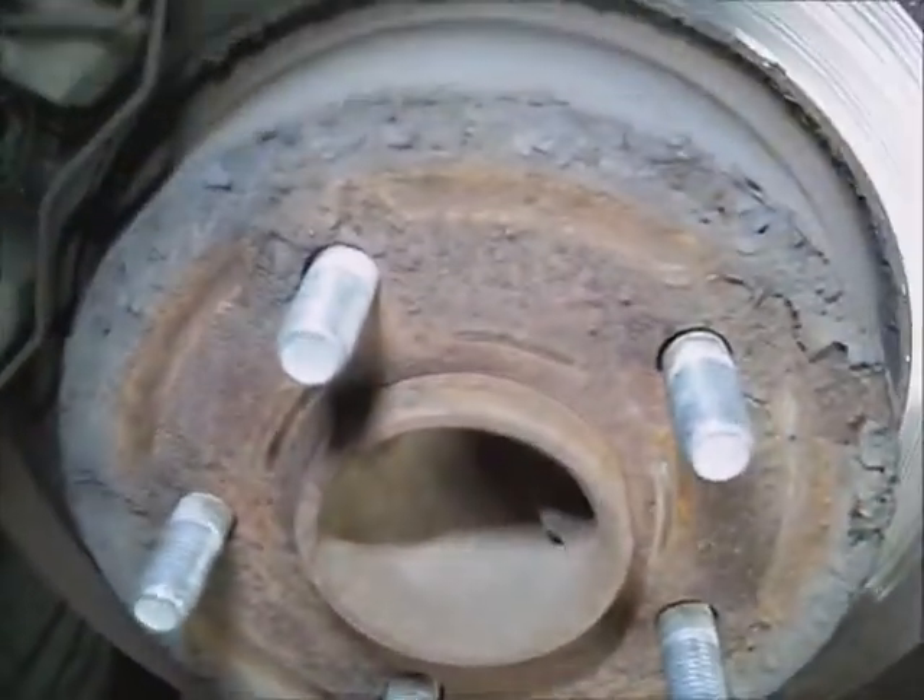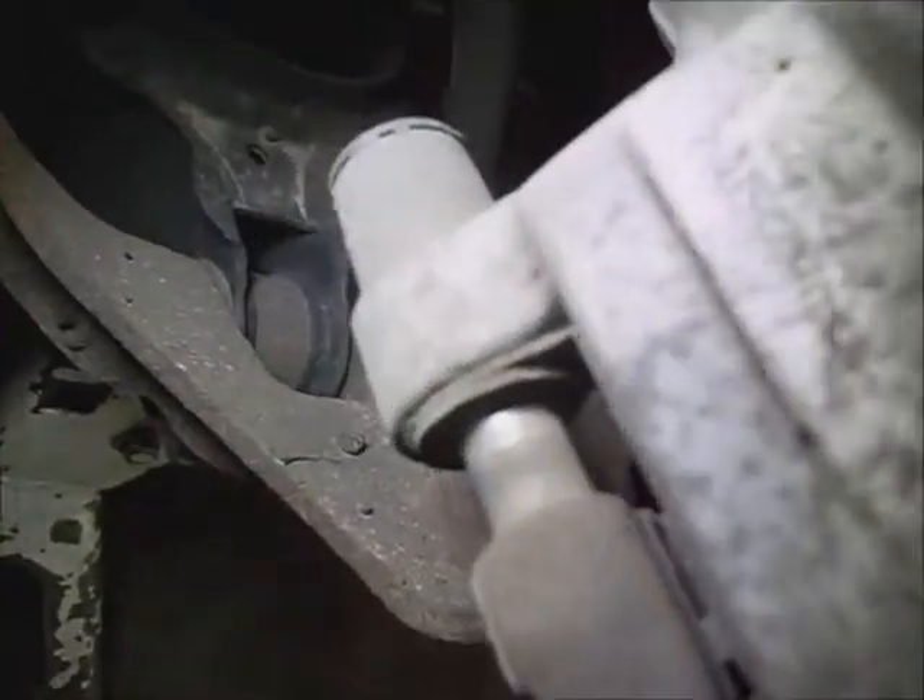This is just the outside; the inside may or may not be as bad. But it's getting new rotors. I believe these have a cap plug on the two caliper pins and a 7mm Allen head in them.